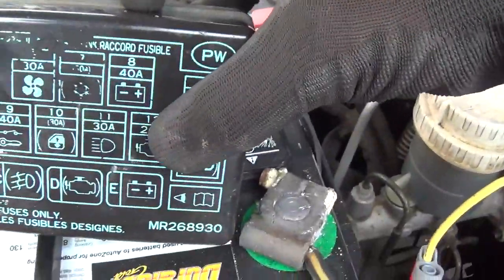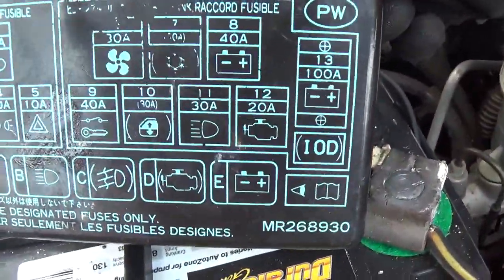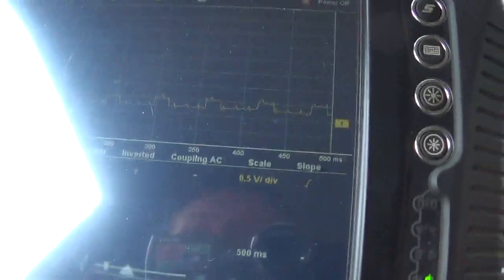And I found this guy blown, and it's a higher amperage than the stock 20 amp that's supposed to be in there. So it even blew a 30 amp fuse. Now this fuse is basically everything that has to do with engine controls. Here's what the current looks like right now in that fuse — nothing excessive, about 5 amps.